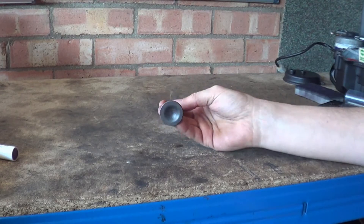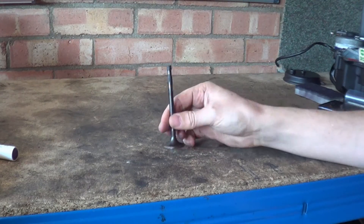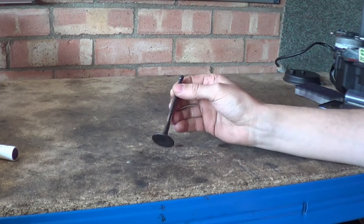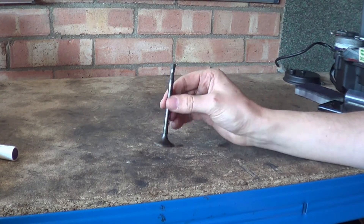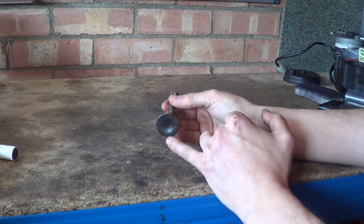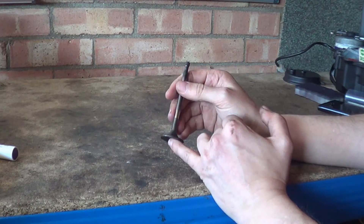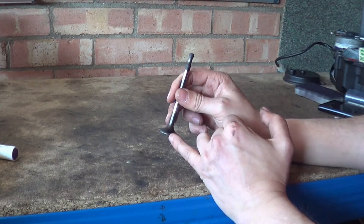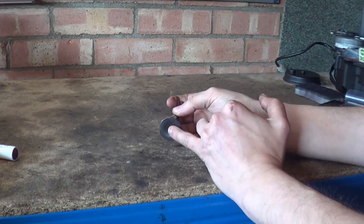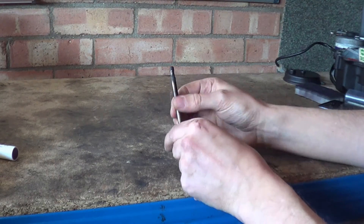This is officially known as a poppet valve and it basically has two parts: the valve head, which is the big trumpety bottom bit, and the valve stem. When these are manufactured, the head is machined or forged into a basic profile, then it is hardened and then ground. This surface here is ground onto the valve — some have dimples, some don't, depending on the combustion chamber design.